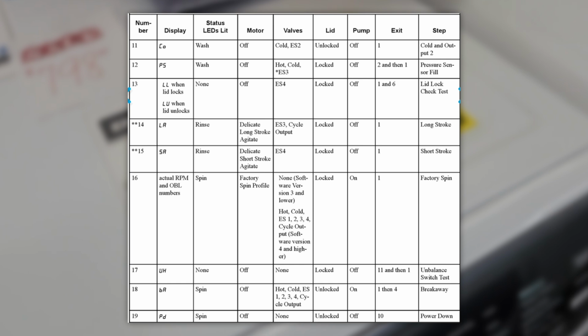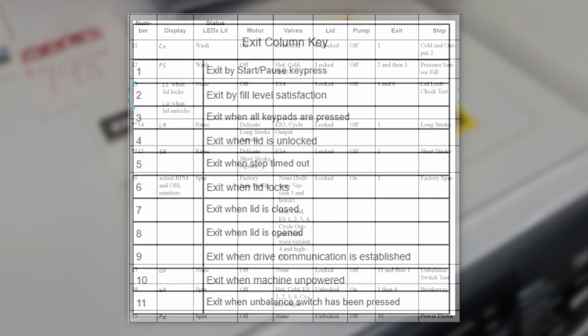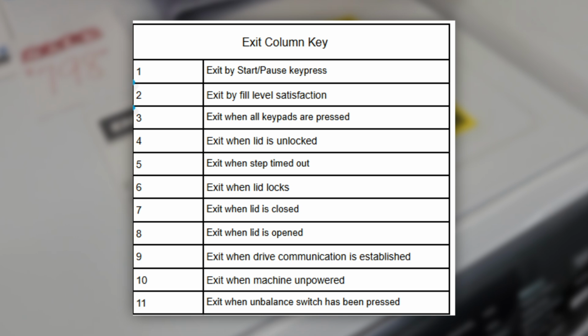Also, the agitation modes are going to be quite a bit different because it's a top loader rather than a front loader. Next, this is how you would cycle each test on the TR7. Again, very similar to how we ordered everything in terms of pressing the start/pause button or having to let pumps or valves run, with a few minor variations. Refer to the last screens in this one for the proper sequence to advance the test as needed.